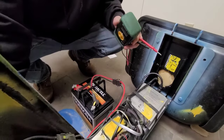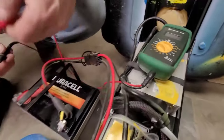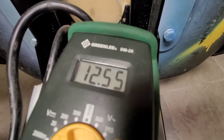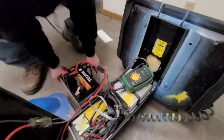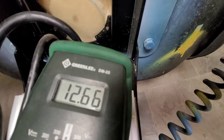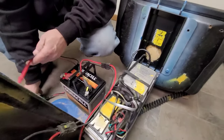The next thing is to see if your charger works. The easiest way I found is to put your voltmeter on 20. You'll get a standing reading — it'll give you a 12.54, it'll stay there, not rise. Now go ahead and plug in the cart. You're going to see that number jump up and continue to rise — three, four, five — and that's telling you this charger is throwing voltage to the battery. The charger is good; nothing wrong with it.